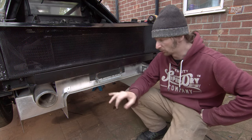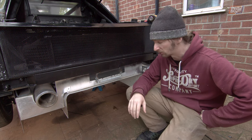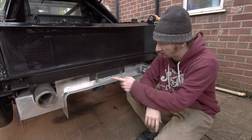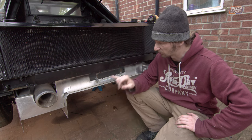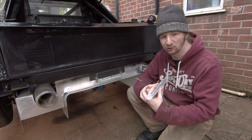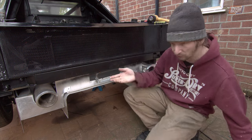One thing we neglected a while ago is that when we installed our fog and reverse light here, we didn't check one of the legal requirements — it's supposed to be E-marked. I'm pretty sure when we ordered it we checked the listing, but whether we did or not, there is no marking visible on it. When the IVA examiner looks and sees no marking, he's going to fail us. So before that happens we're just going to pull this off and replace it with the much more expensive, actually certified, actually marked one from Car Builder Solutions — the one we didn't buy previously because this one was so much cheaper.